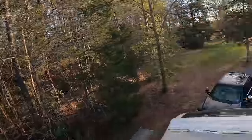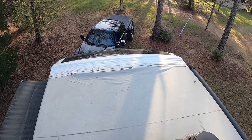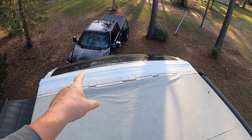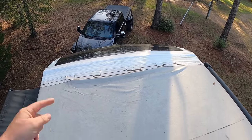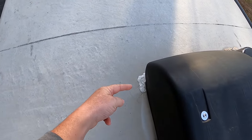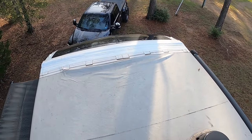I'm up here on the roof and I might as well show you the problem we've been having. You ever see those campers driving on the highway and the whole front end is aired up with air and you can see the roof like it's trying to come off? Well, we've been one of those people for a while. I've used Eternabond tape across the front cap to try to hold it in place, but it has now stretched and is airing up all the way to the front AC unit and it's actually starting to get a hole right there. Today, we're going to fix all this — rip all this roof off and install RV Roof Armor.